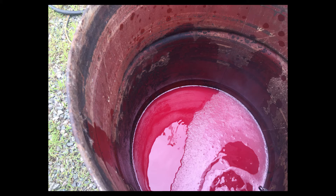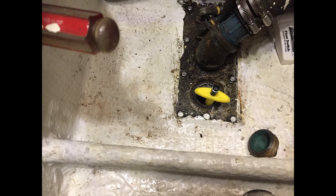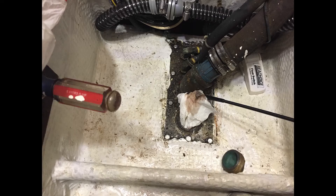After he cleaned up and packed up, he made the recommendation that I go in through the access hole in that main tank and clean out as much as I could on the inside by using one of those little parts pickup tools and some paper towels. Here you see me with a clean paper towel going in through the access hole, using that pickup tool — here it is all the way down inside the tank — wiping up the inside as much as I could, and then carefully removing the first of many paper towels, in fact the whole roll.